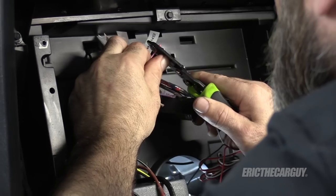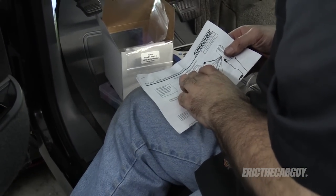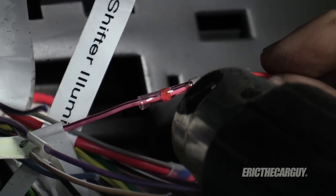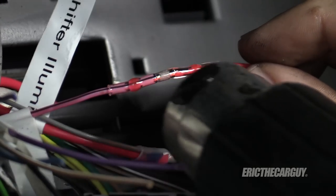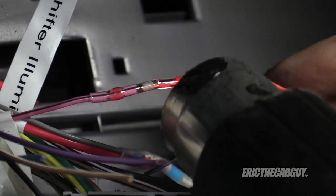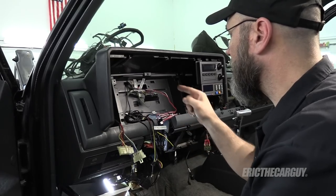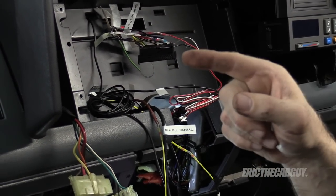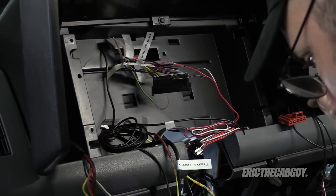Here's a look at the wiring I'm about to do. These are the three main wires — they go into the main power distribution from before. The top needs to go to 12 volts keyed ignition, so the red wire is going to go to that. The black is going to go to ground, and the 12 volts dash lighting goes to the white wire — and that's to illuminate the needles on the gauges. This is the ignition hot going to the red wire — keyed ignition, red wire confirmed.